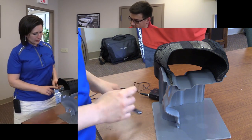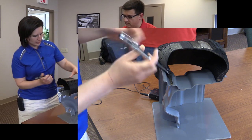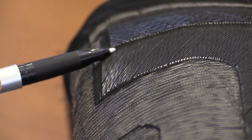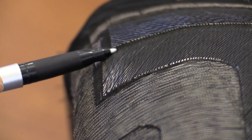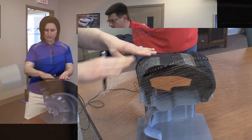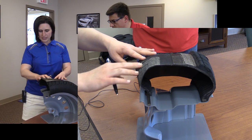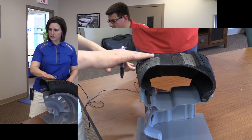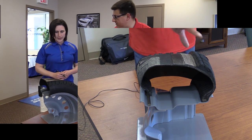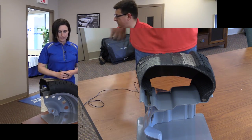On top of that there's a component known as the wedge. You go from these rounded polyester fibers to this flat belt — to make that transition there needs to be sort of a triangular cushion that flattens that belt and fills that space from the rounded polyester up onto those steel cords. That's known as the wedge. The bottom of the tire is flat versus round like a bicycle tire would be — yes, exactly.